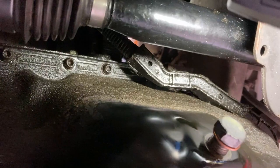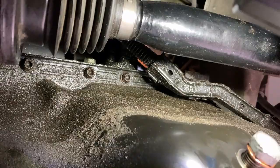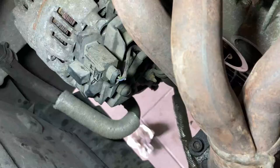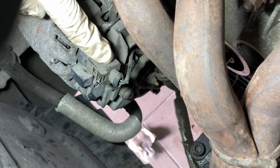Before I remove the oil pan, it's very wise to give this a clean and remove this wire loom from there — it's going to bother me a lot. It's connected to the alternator. Removing wires from the alternator means removing this plug — there is another one here and then down there.